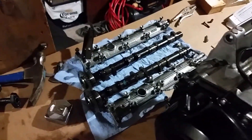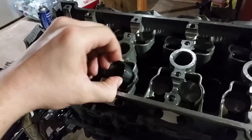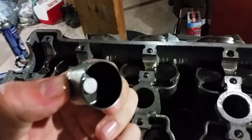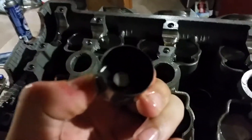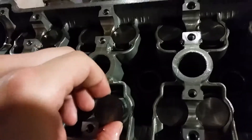Here it is with the cams removed. I've got a pair of vice grips and a zip tie holding the cam chain so it doesn't fall down inside the engine. There are the cams and holders over there. These are your buckets — the tappets. Inside you get your valve spring, and when you pull these out, that is the shim right inside of there. It's usually going to get stuck inside, but if you tap it at all it's going to fall out, so just be careful you don't lose it.